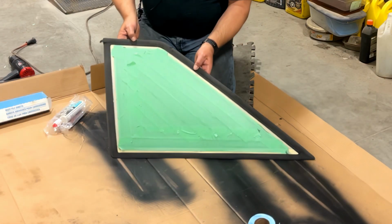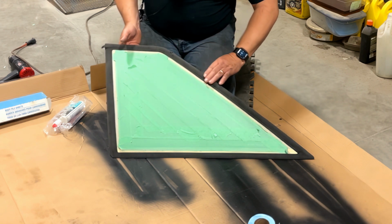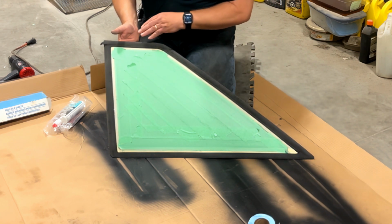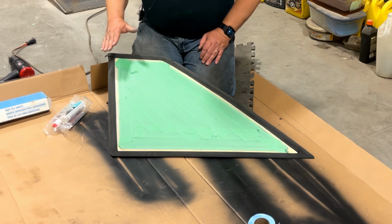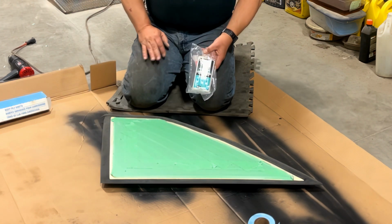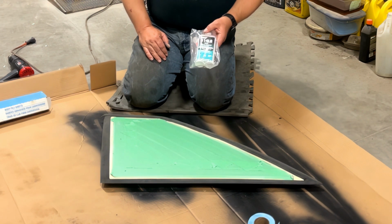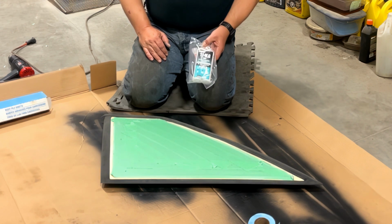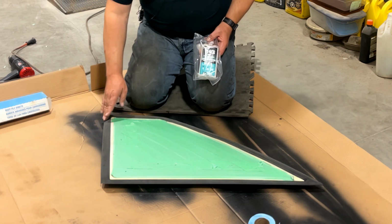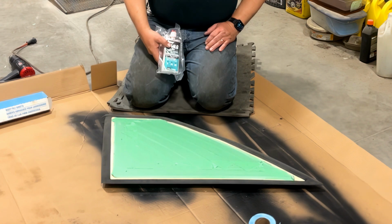Okay guys, I sanded this whole thing with 100 grit, just with a hand Durablock. And I've got it so that that pebbly feel that we all know so well is gone. You can still see lots of imperfections on here, but that's okay. We're going to move on to cleaning this up and getting it ready to use a special plastic skim coat, which is this Fusor 114 LG skim coat. That's made for plastic bumpers and stuff. My go-to body guy says this is the stuff for something like this that's flexible, because this skim coat will be flexible. It's insanely expensive, but we're gonna put it on here and give it a try.